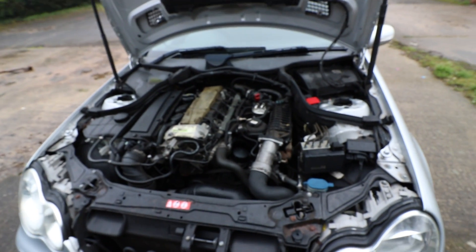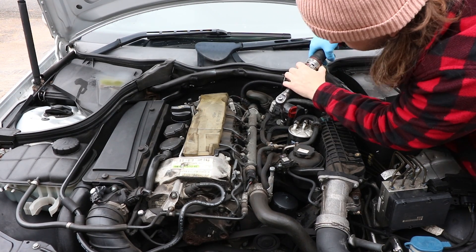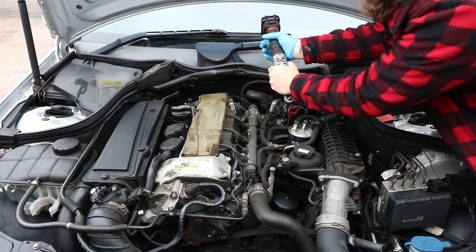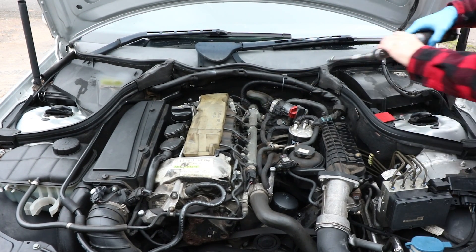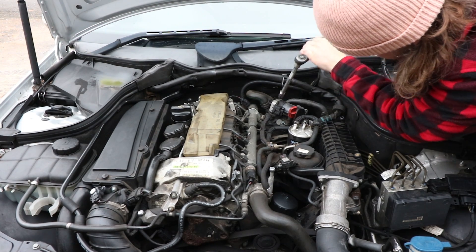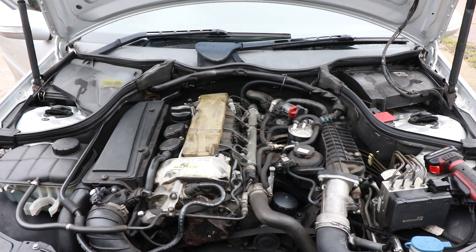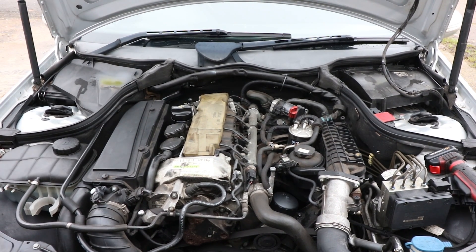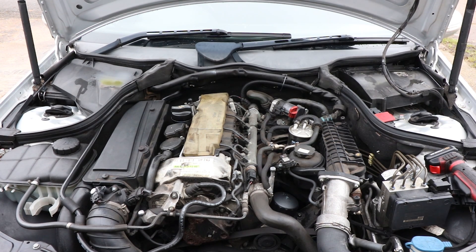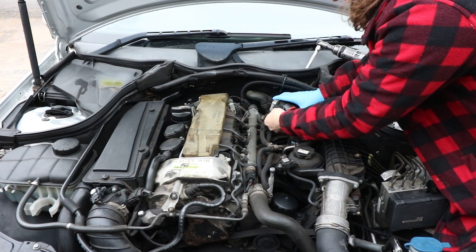Once it's free you can just move it out by hand. I've got an E11 bit here — I backed it out a little bit but it's still welded on there, so I'll back these out a little bit more. I'm going to start the car and give it a rev. Hopefully that'll be enough to free it up, so I'll take these out the rest of the way. There we go — nice and loose now.